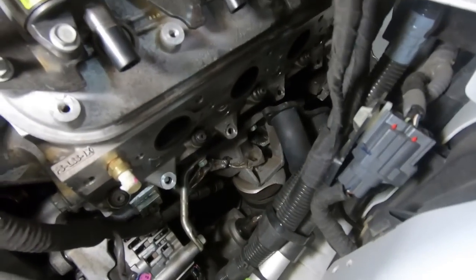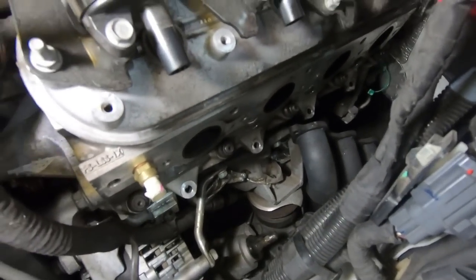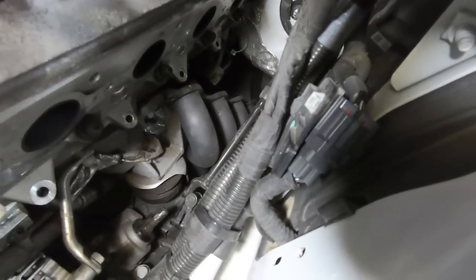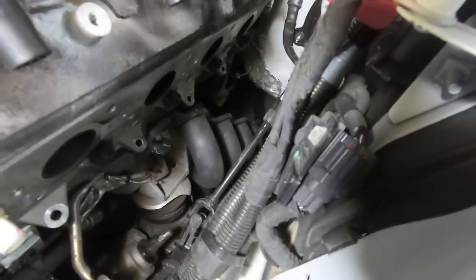So I'm back up top, and I ended up having to unhook the steering column. I think there's a couple reasons for this, guys. This thing has 6-bolt heads on it, and it just wouldn't sneak past those flanges. Chances are with stock heads, you could thread those right up in here, but it just wasn't happening. So there's an 11 millimeter that holds that together down there. I took that off, and once I did that, you can see the header is going out nicely. So I'm going to go ahead, lift this thing back up, and we will get the header out from the bottom.